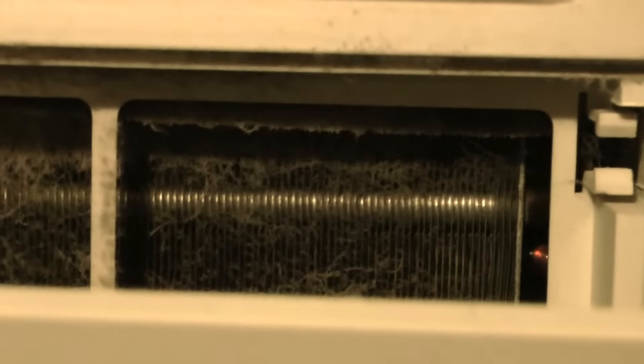During the winter time I'm going to be pulling this out to clean the coil, and I'm going to find a way to modify a better filter into this thing, so it doesn't keep clogging up the evaporator coils. Because sooner or later this will clog up — and that's probably why these things only last like five years. Many people don't clean this, but it goes beyond that.